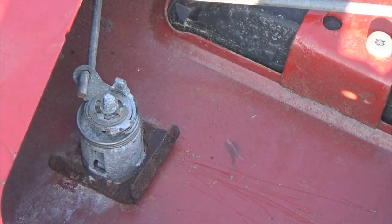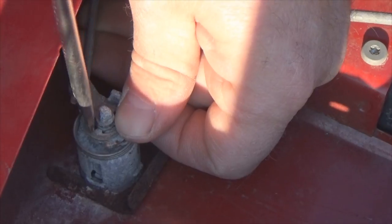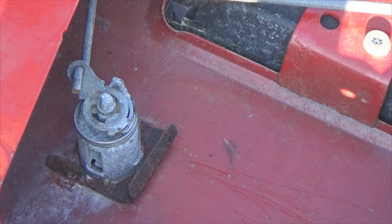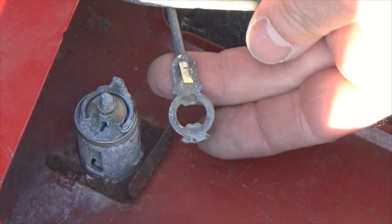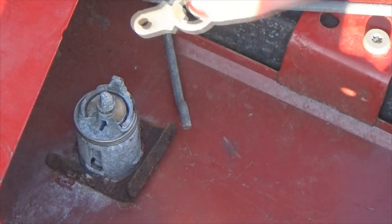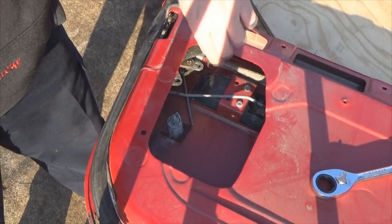Now we're going to unhook the cylinder lock e-clip right there and remove it. To remove the e-clip, take a flat blade screwdriver, get behind the clip and gently work that clip out so it doesn't go flying somewhere. There's the e-clip out. Then lift this up, this comes off, this comes over. To save yourself some headache of losing this, raise it upward, bring it over, and just take it out. Now we have the lock cylinder rod loose.